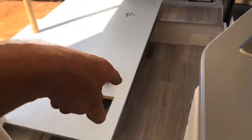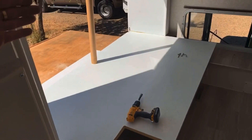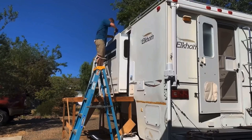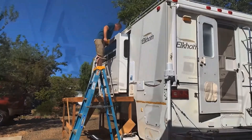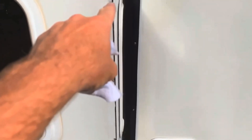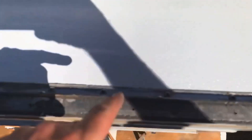I've got these just a couple tacked in here with the shims. Now I'm going to run the slide out back out just a little bit and get this exterior wall set. I used adhesive behind each one of these seams where the sidewall meets the face wall, and used three-inch coated screws to go through the face wall into the sidewall. Up top, there's an angle bracket with sealant — adhesive sealant — all underneath that as well. I just need to clean up the excess.